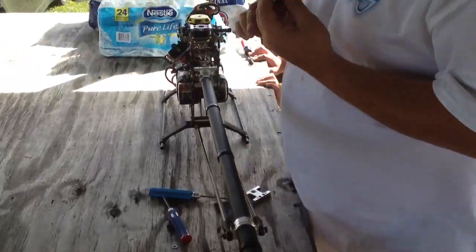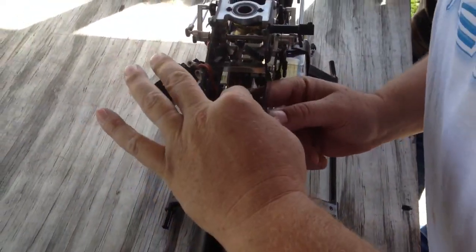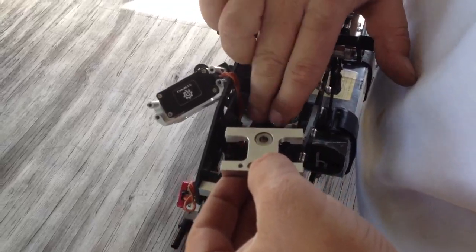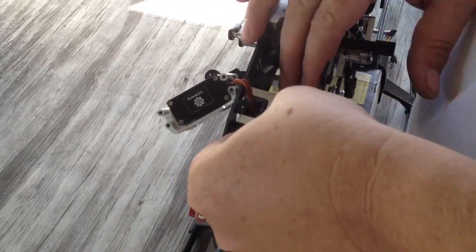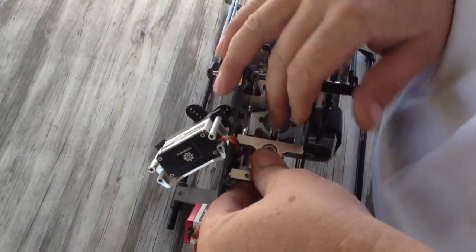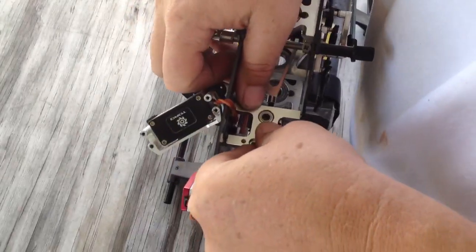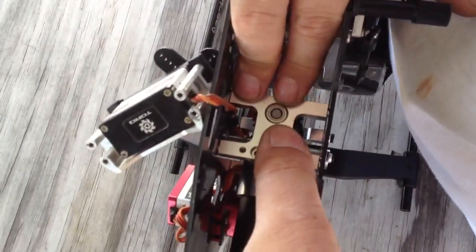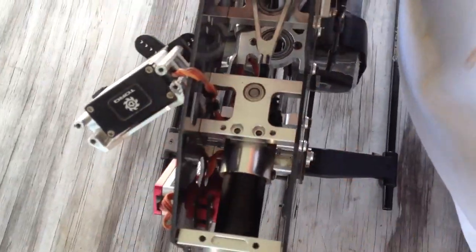And then grab your other counter gear here. Put it right back in, line up the shaft. That's back in installed. Right here, guys, just take that bearing hole and try to keep it sliding straight down and put it right back over top of that gear. And don't worry about lining those bolt holes up. You get them to snap in after you grab that shaft. So yeah, as you can see, you're getting a snap right here. And it all just snapped itself right back together.